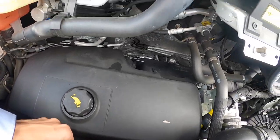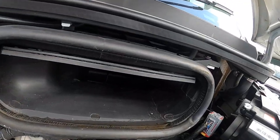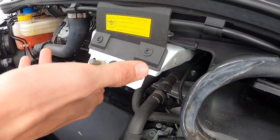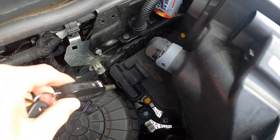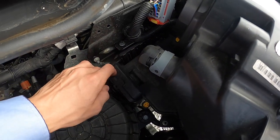You've got your oil filler and your oil dipstick — the red dipstick — for checking your levels before you go away. You also have your paint code there for the grigio aluminium paint, which is a standard Fiat colour available from any Fiat dealership. If you were to jump-start the vehicle, earth your negative — black jump lead on here — and your positive would go onto here. This cover normally sits down; put your key in the side to lift it up and then put your red jump lead onto that for giving or receiving a jump start.